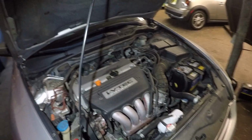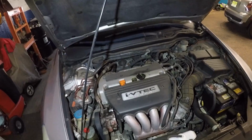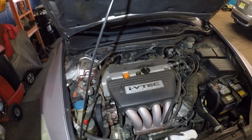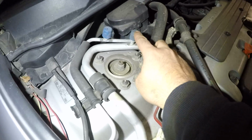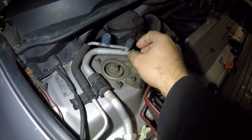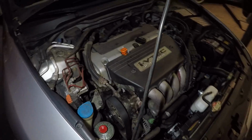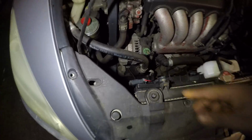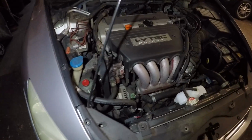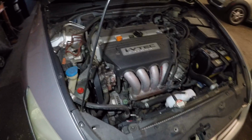Sometimes, before we go, sometimes you do that, your AC does not work, now you need to go further, right? Sometimes you might not have Freon in the system. You could open one of these caps, poke the pin in there, you should have pressure in there, right? If you don't, you can check power onto that cable sitting right there, because that's the one, sometimes it could be a bad AC compressor, right? Those are the common problems.